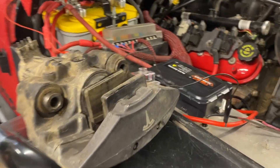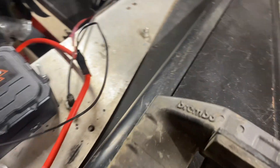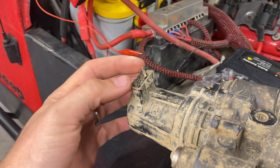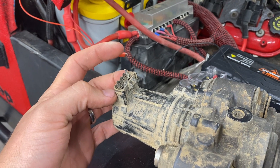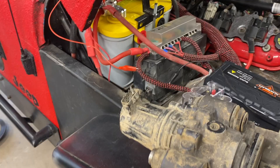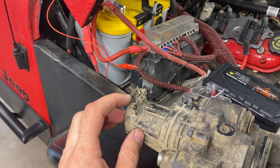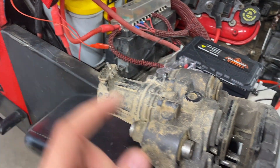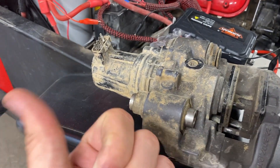The parking brakes I use are from a Tesla and they're manufactured by Brembo. The Tesla harness has four pins. We're going to use the two outside pins and we won't use the two inside pins. If you hook positive or negative to one pin, do the opposite to the other one and the piston will go either in or out.